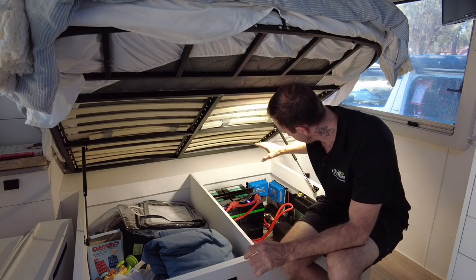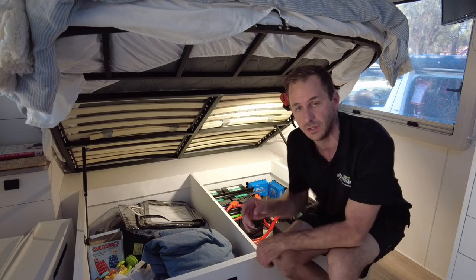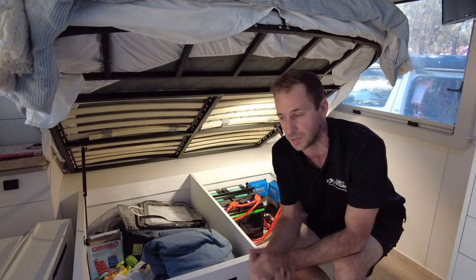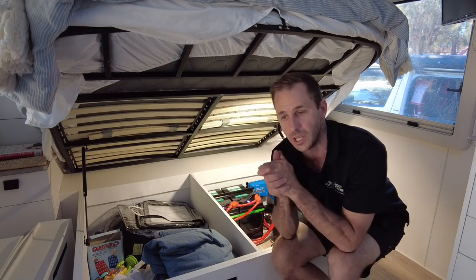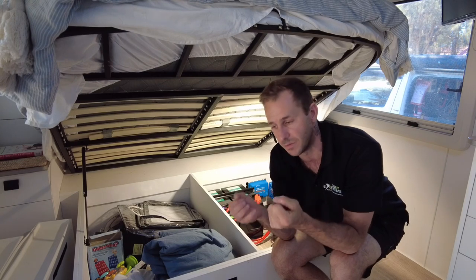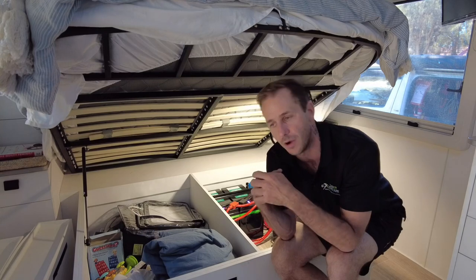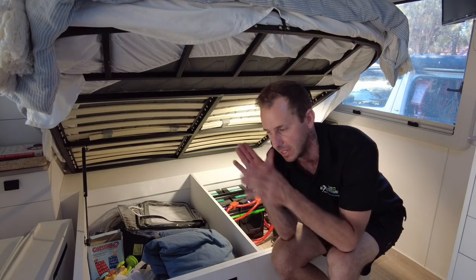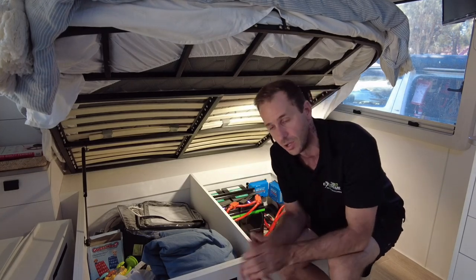And what we've got here is the Redarc 50 amp DC to DC charger, charging from old mate's tow rig, in this case the 200 Series Land Cruiser. And we've checked his Anderson system on that, and thankfully, whoever did it, they ran really thick cables, and we're very happy with that. So 6 B&S is on that run, we're very happy. It was via an isolator, and it was sharing a line with the three-way fridge, but we've rectified that. It's on a direct line now.